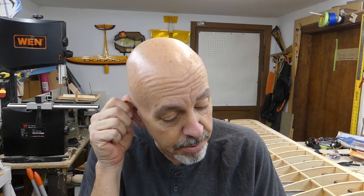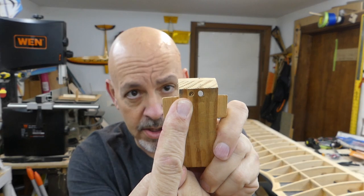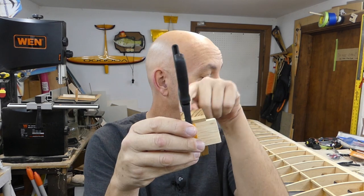Now what we're going to use for that — this tool's been used and abused many times. The ailerons on the Piper Cub are the same way as on the D7 — it's a top hinge. Back in around 2012 I made a little jig for putting the Robarts hinges in, because instead of going flat hinge we're going to go with the little Robarts. This one has it for the large size and also for the smaller size. All we're going to do is come in with a little clamp, put it on the aileron or the wing, clamp it into position, and then just grab the drill and run it through.